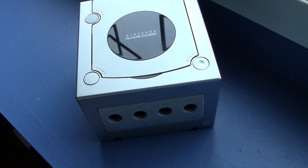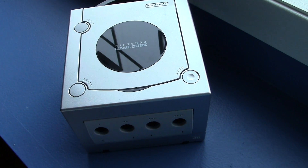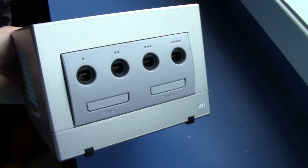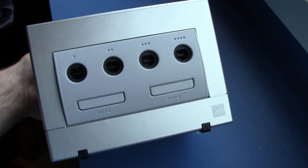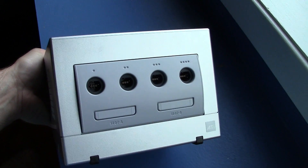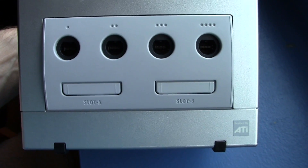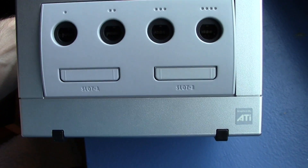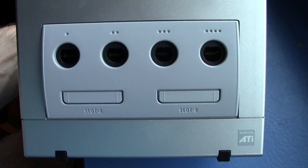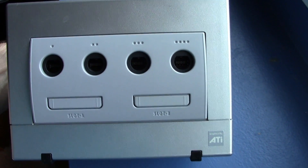After letting that piece sit out in the sun for probably another eight hours — basically as long as I had direct sunlight — I pulled it out, let it dry, and then put the whole GameCube back together. I'm trying to do this in natural sunlight because that's really the only way to see the actual color. Under fluorescent or tungsten lighting it's really hard to tell. Basically here's what it ended up looking like — there's just a little bit of yellow left. It's the slot B door cover that had the most yellow, and there's just a little bit still there. I have a feeling another pass might get it closer, but either way it's still a heck of a lot better than it was. That door was really, really yellow, and now it's not quite so bad.